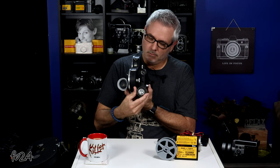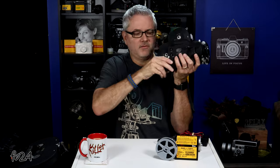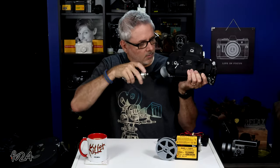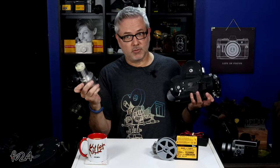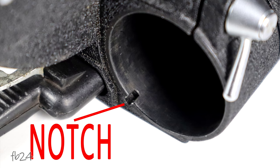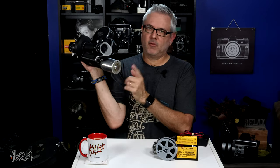These motors are very easy to interchange. Open this little lock counterclockwise and wiggle the motor out. The little pin on the end engages a little rubber boot inside your camera — that's what drives the entire system. Those rubber boots can get hard and cracked, so they sometimes need replacing. The motors go back in the same way they came out; there's a little pin on the side that has to engage a little notch. Slide it in, engage the notch, tighten the lever, and it's in. This has the 24 fps crystal motor.